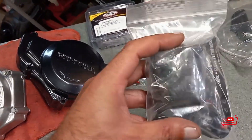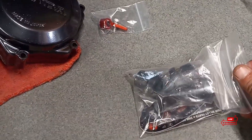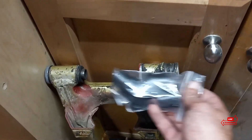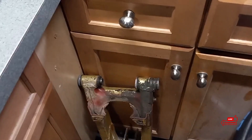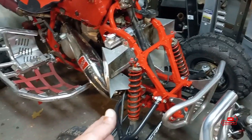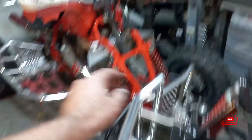Here we go — we have the Delrin swing arm bushings. Instead of using the needle bearings and whatnot, these just replace all that. It's a lot simpler. Here's an 86 swing arm here — one on each side of each part of the swing arm is what goes in there. I'm actually going to powder coat that black before my sticker kit gets here so we have a nice black swing arm to match everything that's on there. Also, I'm going to get a rebuild kit for the Full Flight A-Arms. I'm going to leave these on this quad, but I'm going to re-powder coat those because it's a little chipped up. I'm going to throw some 450R shocks on this 250R as well — I have a bunch of sets of those, so we'll put them to good use.